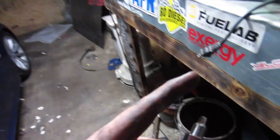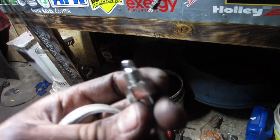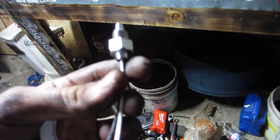We have the compression fitting on the brakes. I've really got to test drive it to tell if the brakes are any better. The pedal still seems kind of squishy, but that could be another issue — I just gravity bled the brakes, I didn't actually pressure bleed them. Maybe I could do that on Friday and stiffen up the pedal some. Also, I'm not sure if you guys remember when we first put our built trans in — we went to put our trans temp sensor in and the tip of it got crushed inside the trans. Ever since then I haven't been running a trans temp sensor, which is terrible. I'm getting ready to install this real quick and then we'll go test drive it.